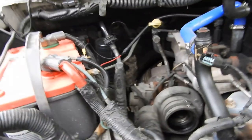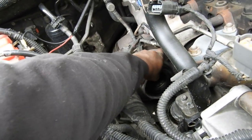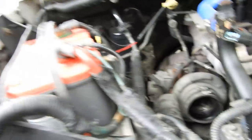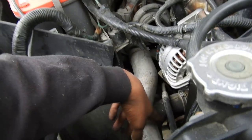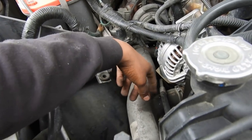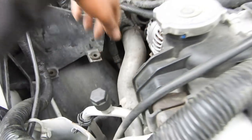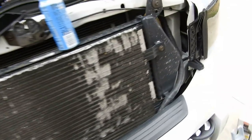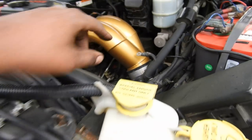But that's not what this video is about — it's about getting the intercooler installed. I already got the airbox out of the way, so you can see you now have access to your hot side pipe coming from the turbo. We're going to go ahead and loosen this from the turbo side, disconnect it, disconnect this side, and get her out. Same thing on this side — you're going to take it off down here, take it off from your intake manifold side, and then we're good there.